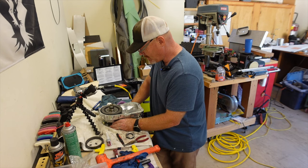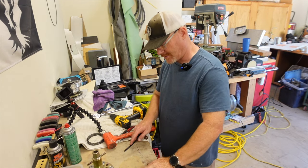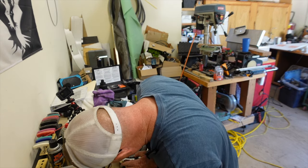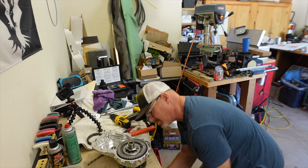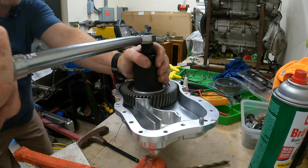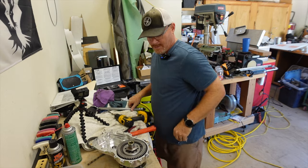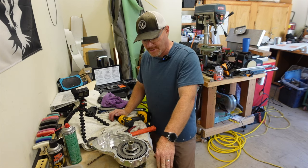I need to make sure I have a torque wrench that goes that high. Then we'll put that nut back on and this one will be ready to go back on the airplane. I went ahead and sacrificed two holes into my workbench — used the other prop flange as a template — so I should be able to take the gearbox now, line up these holes, put a screw back into them. Looking for 150 foot-pounds — that's what's set on the torque wrench right now. There we go. Clean off the excess Loctite. That's ready to go back in the airplane.